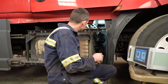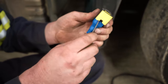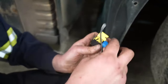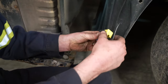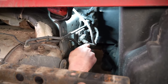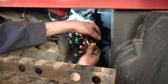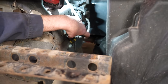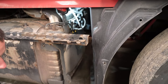We're going to test the inlet side. To do that, we've got to get up in here with a little pick because of what the connector looks like. You've got to kind of get up underneath the NOx sensor — pull it out as you push. These are kind of weird: as you push them in, you've got to press down at the same time, and when you're taking them out, you pull up and out at the same time. I have no idea why this one has oil all over it. I'm going to spray it out with some non-chlorinated brake cleaner to get that oil out because I don't want oil all over my plug.